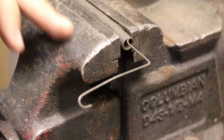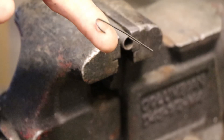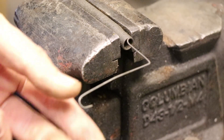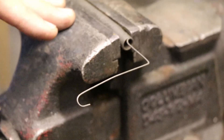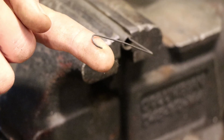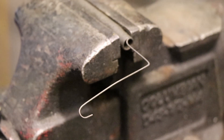This torsion bar system is really your coilover suspension built into a single bar. The bar itself actually flexes to create suspension, and then you have a shock to accompany it for major absorption. When we come over a bump it comes back down; if the front suspension goes over a gap where it's unloaded, it comes right back to where it needs to be — full range of motion with our lower control arm, giving us a smooth ride. If the suspension is way too low you'll run into your bump stops; way too high and your camber will be way out of alignment.